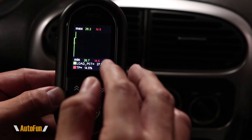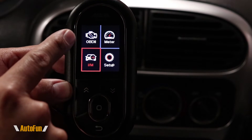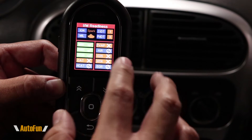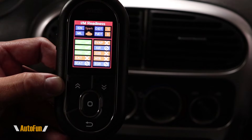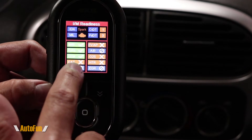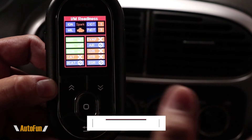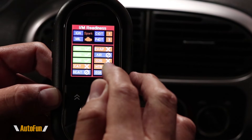A lot of this is great for basic troubleshooting, and there's more available with the app. There's also a standalone emissions readiness function — separate from the OBD2 menu — that simplifies the display into a color-coded screen. Green means good to go, and ideally everything applicable should be green. For example, the catalytic converter shows an 'X' meaning it's not ready yet and must turn green before going to smog, while 'not applicable' items I don't need to worry about.